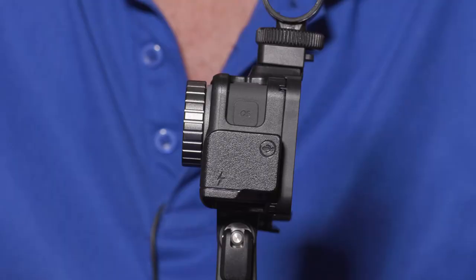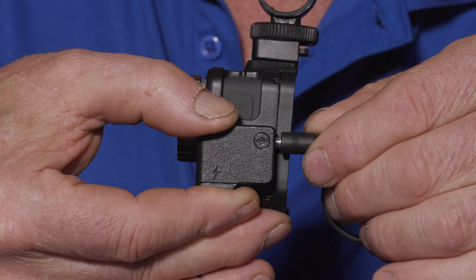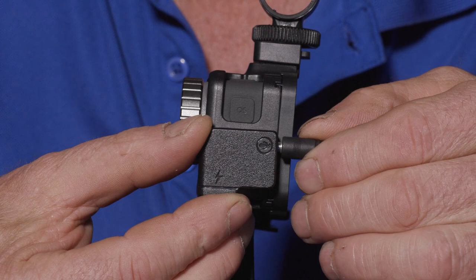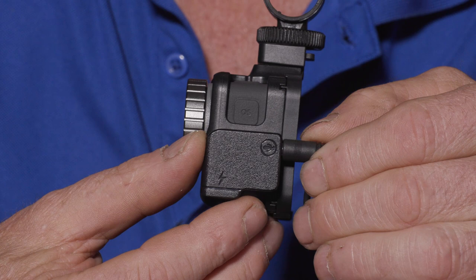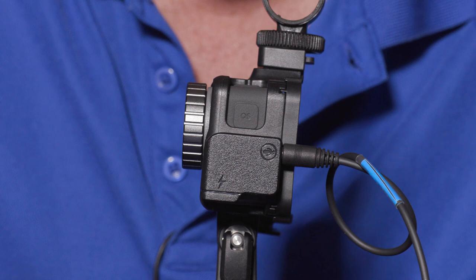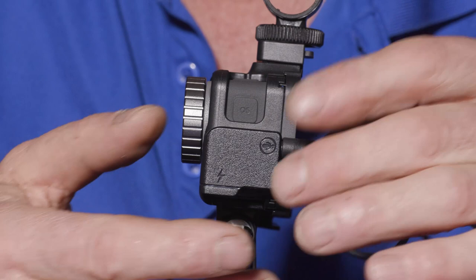I've worked out what's going on with this audio adapter. When I've plugged it in it feels like that's as far as it goes, but you actually have to snap it all the way in. It wasn't quite connecting and that was causing dramas - it was taking photographs without me telling it to, and shutting down videos while I was talking. Once fully seated, the audio quality is really good. My Sennheiser lavalier kit actually works with this - everything is hunky dory now.